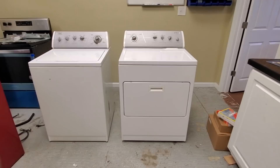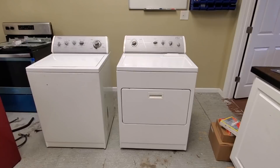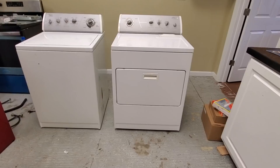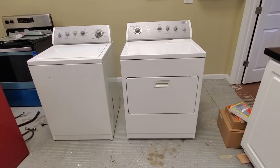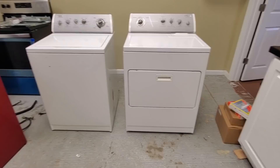The type of washer and dryer you want to buy is the ones that have manual timers. You don't want to get into the ones that have computerized components. If you sell them as resale, you're usually going to give a warranty — maybe 60 days, maybe 90 days. If you give a warranty and that computer board goes out, it can cost you three to four hundred dollars by itself. You want something with a manual timer so if the timer or pressure switch goes out, you can replace those individual items cheaply.